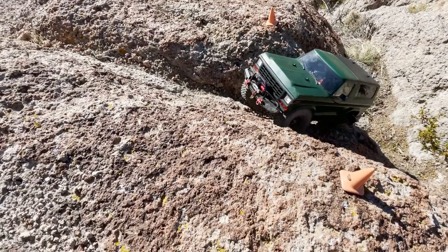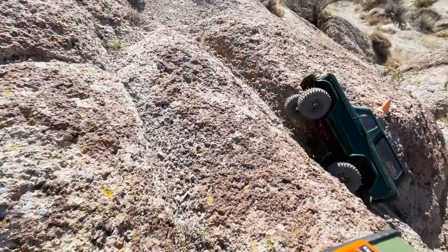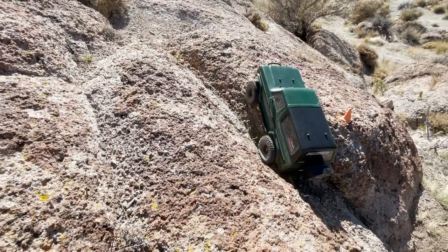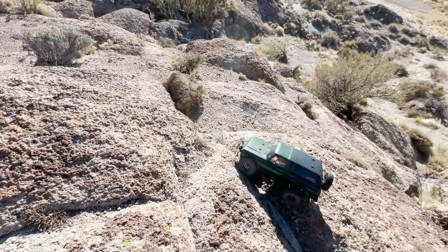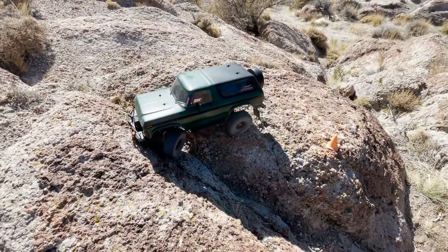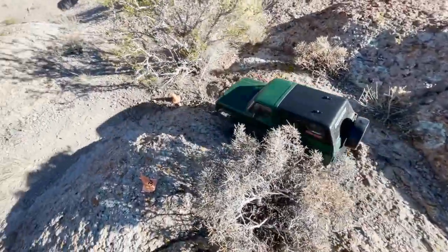If all you're looking for is performance and you're trying to make a class 2 crawler that's going to kill it in competitions, I don't think doing something like this is the road you'd want to take. If you're trying to be budget conscious, you'd probably start with an SCX-10 II builder's kit, add some Rock Pirates parts, and you'd almost spend less on that entire build than I did on brass — and you'd outperform me on technical climbs. That being said, this truck's really fun. Adding a lot of weight down low has made it really planted, made it side hill pretty well, and made it take really steep climbs amazingly well, especially given how big of a truck it is. Really helps keep the front of the truck down low as you're climbing and ascending, and helps settle the suspension so you don't have as much jolting up and the truck doesn't want to peel away from the wall.